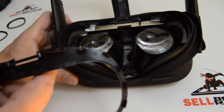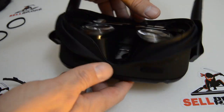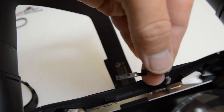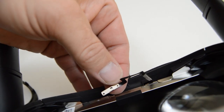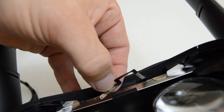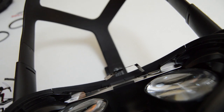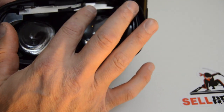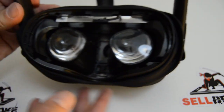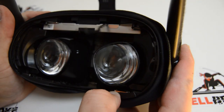I managed to get it free - it's actually not too bad once you work at it. The little melted plastic parts sticking through: use your fingernail or carefully a small metal tool and just scrape away the plastic that's squirted through those two holes, and then you can pluck it up with your fingernail. When you go to reattach this, you'll have to use super glue or plastic epoxy. That allows us to get the face out of the way so that this ribbon isn't in danger of getting ripped.